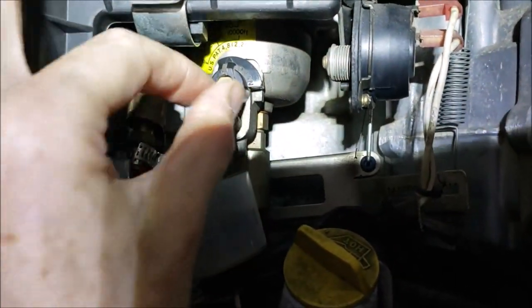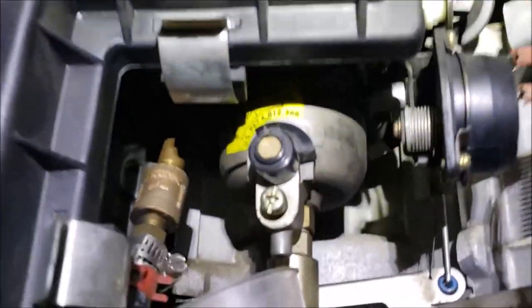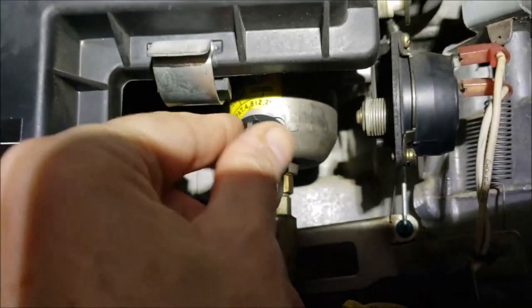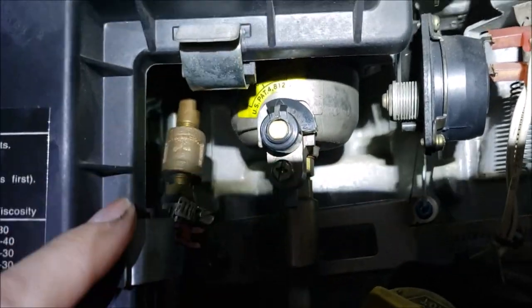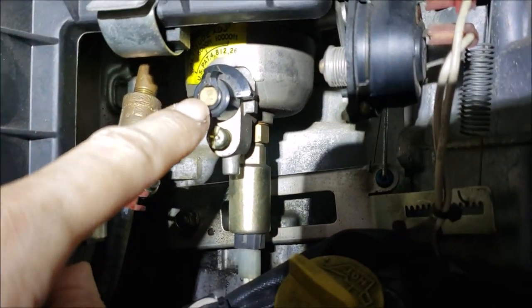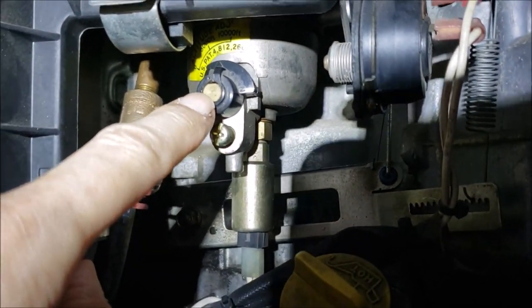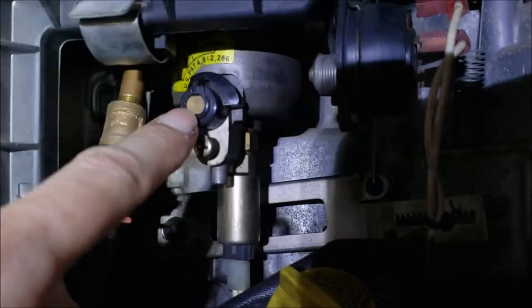You've got this little lever here, and it tells you — from zero to ten thousand feet elevation — that's what it's got up in there. So you're going to adjust your fuel mixture slightly, ever so slightly. But after I took this apart I discovered that this is actually the main jet. The only difference is it's fixed in a position where you can't really adjust it but just a quarter of a turn.